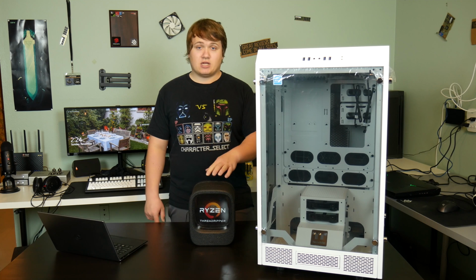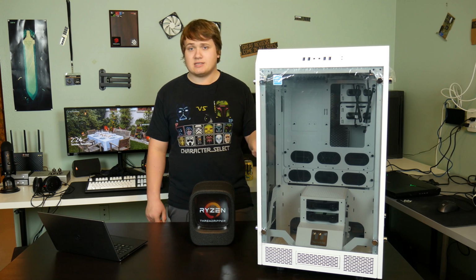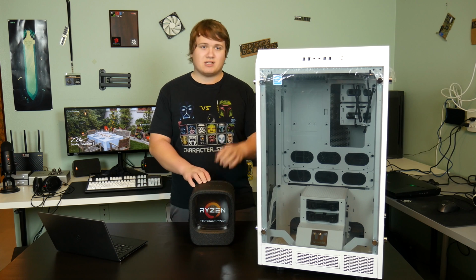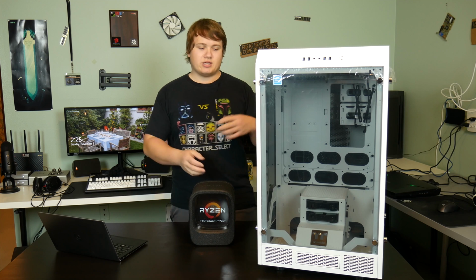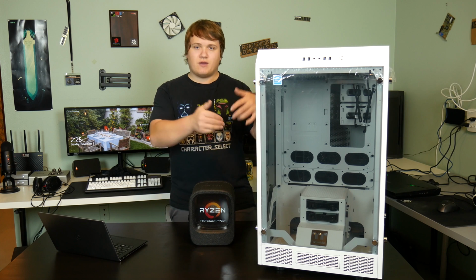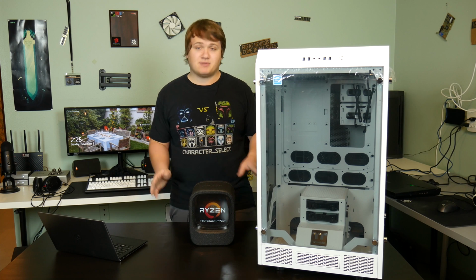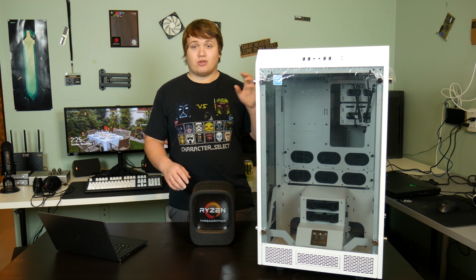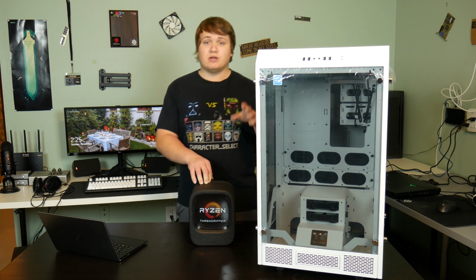Now, as for fan controls, because I'm going to be having like 19 to potentially more fans in this system here, and in order to control all of those, I don't like using motherboard control because the motherboard software tends to be crap. It doesn't look very good in my opinion when you have little fan cables plugging into the board up here. I like to try and keep things that are plugged into the board to an absolute minimum. So I'm going to be using 3, maybe 2, I haven't really decided the quantity yet, NZXT Grid+ V3 fan controllers.